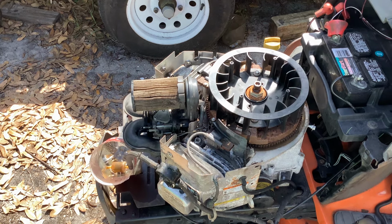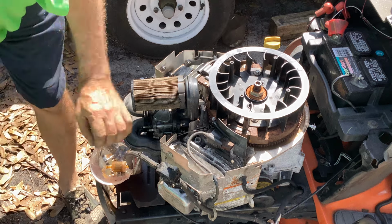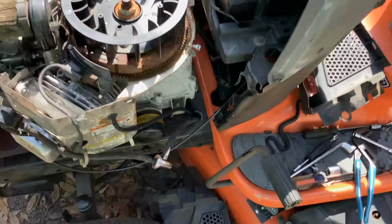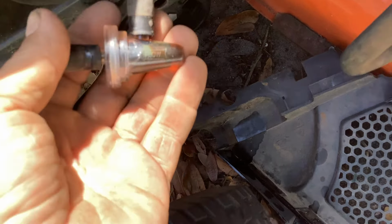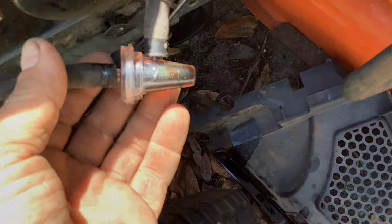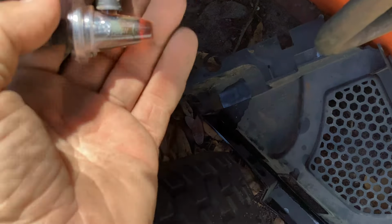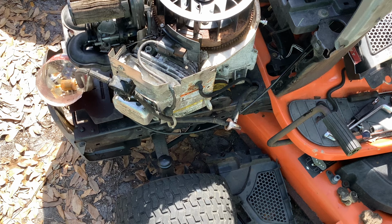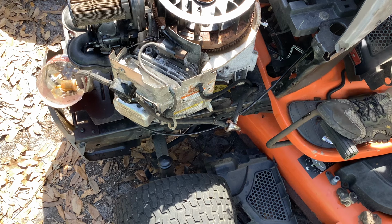Okay, you guys see anything blow out of the hose? Nothing. Oh, wow. Oh, wow. Fill this thing up with root beer. So what are we going to do here? I was afraid that was going to happen. All that brown fuel, and it plugged up my mesh screen. Son of a gun. You can't win for trying when you're working with Husqvarna.